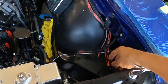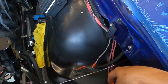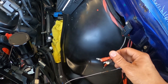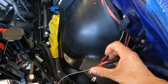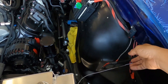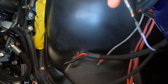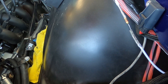You're also going to need an ignition signal, which I already have pre-wired. The fuel pump output — the positive — goes to the breaker, and then those two wires run all the way back to the fuel pump. Aeromotive is nice enough to include 10-gauge wire. Use it — use that 10-gauge wire all the way back to your pump. I already pre-ran that earlier.